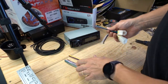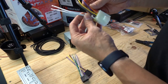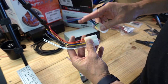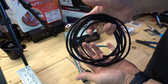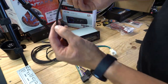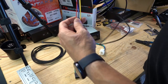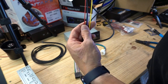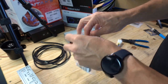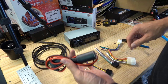I'm going to wire this harness up now. From what I can remember, the Nissan doesn't have a ground, so I'm going to wire up a ground. I'm going to use some spare braided wiring I had laying around — use this as my ground wire and connect it up to the black one.